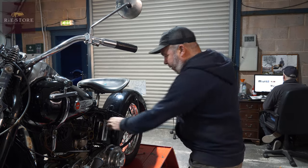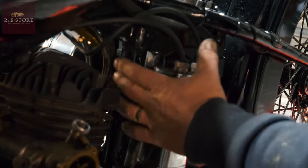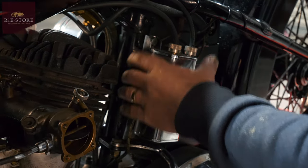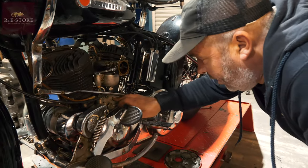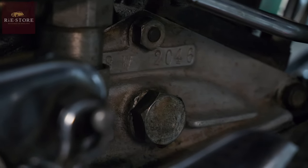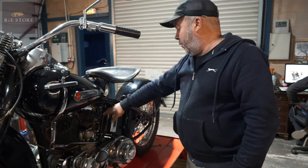It's definitely a 48 frame because of these lugs in here. The civilian's held on with a plate that bolts to the coil and then U-bolts go around the frame tube, but this has got the square studs welded on the frame, so that makes it a 1948. The engine number on there is irrelevant — it's probably been stamped up in Holland because the Dutch put numbers on them to get them registered. That's another misnomer, because they never had frame numbers; the only way you can date it is by little things like that.